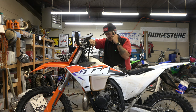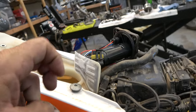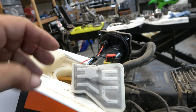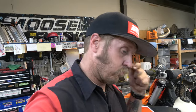So hopefully I'm correct — I mentioned we've had failures of the fuel filter. Look how dark that is. I'm going to pull it off and see if I can blow or suck through it — I don't think it's flowing. I've had quite a few guys have this problem where it runs for a while and stops like it's running out of gas. It's a spongy filter that fills up, runs for a while, but eventually can't flow fuel fast enough. I'm replacing that filter and have one of these OEM ones with a new O-ring.